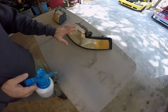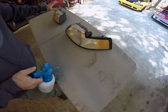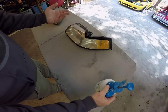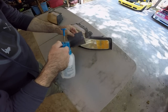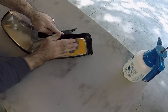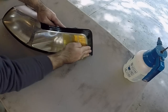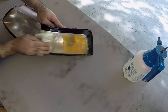There are two different procedures depending on whether you're going to wet sand and buff, or clear coat. All we have here is just a soapy water solution — just warm water with a little bit of soap, which helps the sandpaper glide across. We're going to start out with 600 grit on both of them, because that's a good starting point to get all of this oxidation off. And immediately you can see the oxidation just rolling right off.